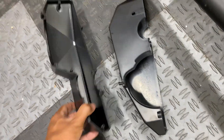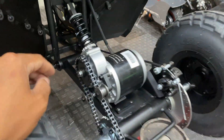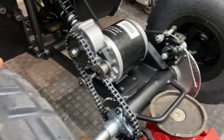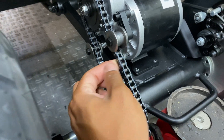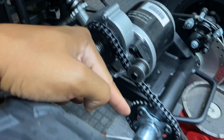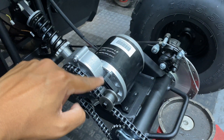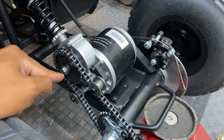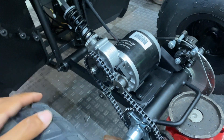There was definitely an unnecessary amount of hardware holding the two plastic covers together on the rear axle — nine total screws holding these two things together. Now that we got the covers off, we can take a better look at the drivetrain. It is certainly a lot different than what I'm used to with the MY1020s. I wasn't expecting there to be dual tensioners, this fat chain, along with a gear reduction housing with a huge front sprocket and tiny rear sprocket. I also wonder if this changes the rotation of the shaft since I'm used to working on bikes with it mounted the other way — I might have to wire the controller switch backwards for forward and reverse.